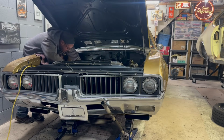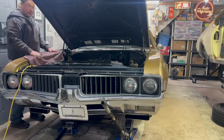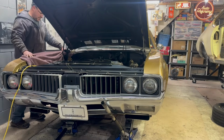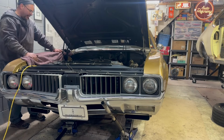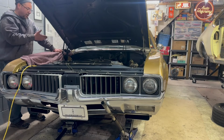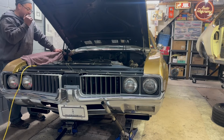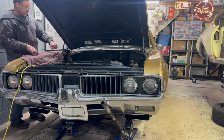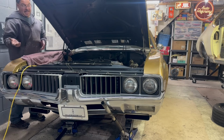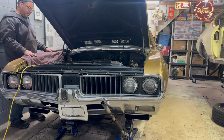So, look, that's that. Gasket's in. All the bolts are started. It doesn't take too long, as long as you're not contending with rusted bolts and rusty old crappy headers. This car has an H-pipe, so that means this header is bolted via the collector to ultimately the other header. That's a big advantage sometimes because you don't take the header bolts off and now the whole single exhaust system on the one side is kind of laying over and fighting you.